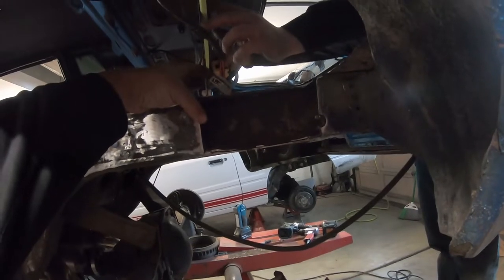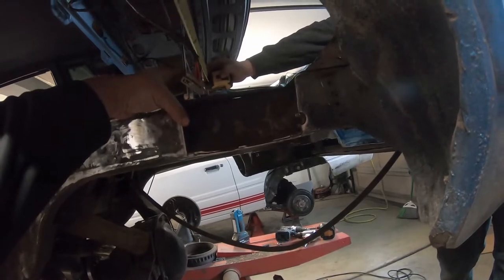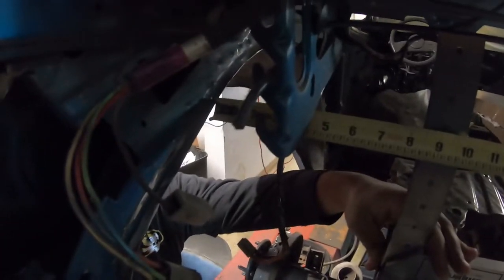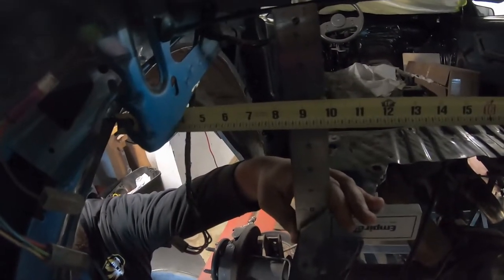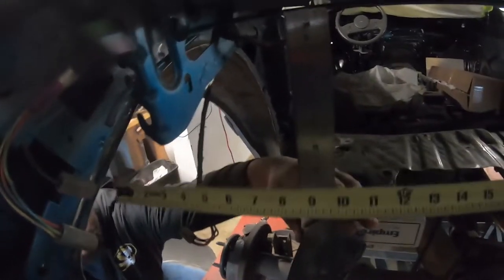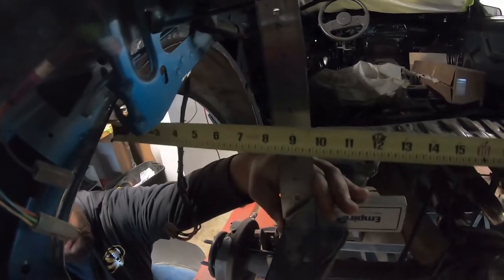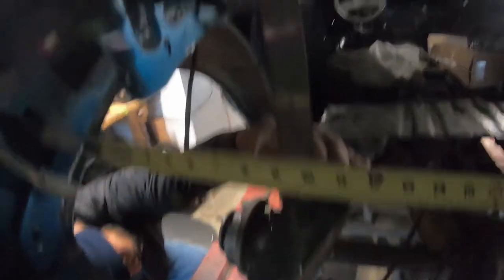That's the same as mine - eight and a half. That's smaller than yours. Mine was eight and a half. No, the passenger side was bigger. The first side was eight and a half, well, eight and five eighths. We're just going to chalk that up to differences in cuts. All we did was set the square on there, measure from our cut line out. I think the tubs are like 11 inches wide - you could technically cut out further but then you get into all the webbing. We left a half inch from the webbing and tried to make it as close as possible. All we did is just measure the width.